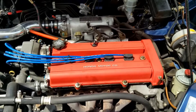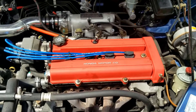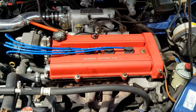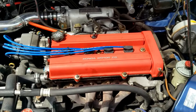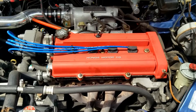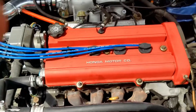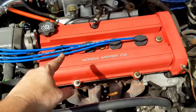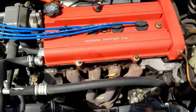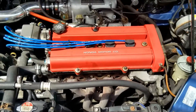It could also be the piston rings, because the car does have 260-something thousand miles. I have checked the oil — it's clean, not milky — and the antifreeze in the radiator is full and clean. So I'm pretty sure it's not the head gasket, but it could be. We're going to do a compression test — a dry compression test — which really only gives me half the story. I need to do a wet compression test as well, but I'm running out of time. I'm also going to work on the AC unit today.